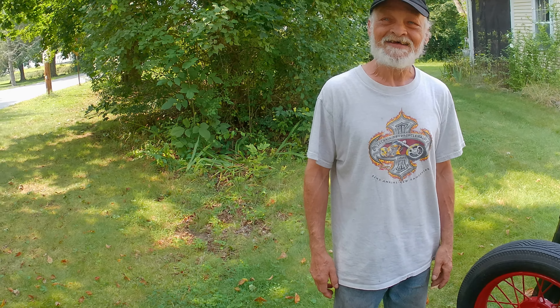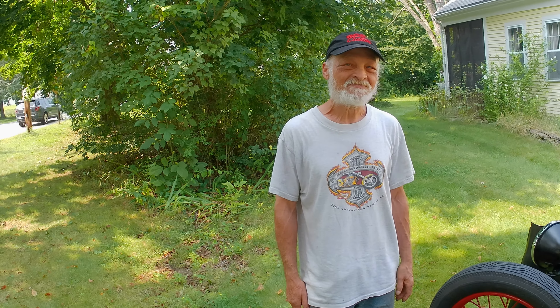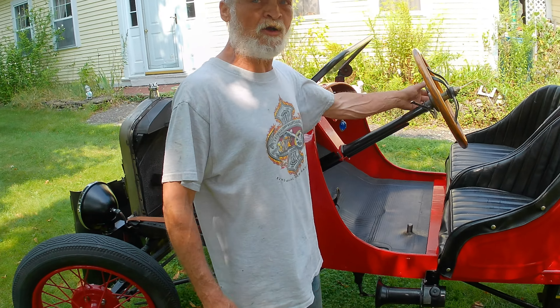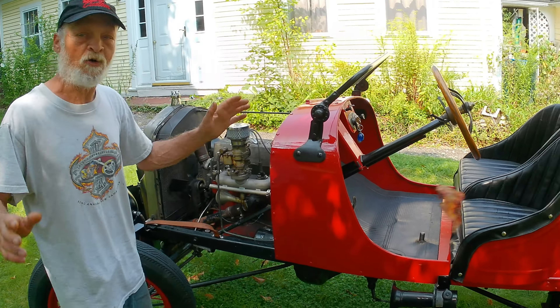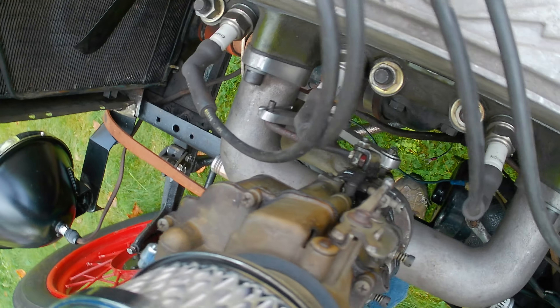I ran out of gear — I was clocked at 65 miles an hour and had no more gear left. Kurt Jensen has a two-speed rear end for me. At 65 you were probably pulling 2600–2700 RPM, and at 55 it's around 2000 RPM. I get the throttle down and it's wide open at just a quarter to halfway — that's through your gearing in the bellcrank.